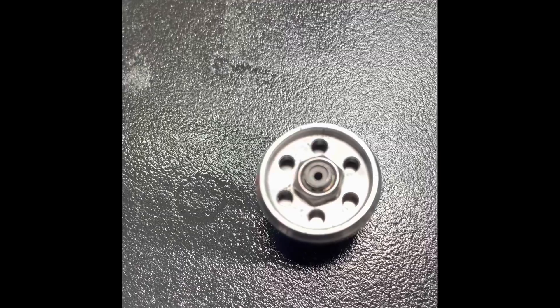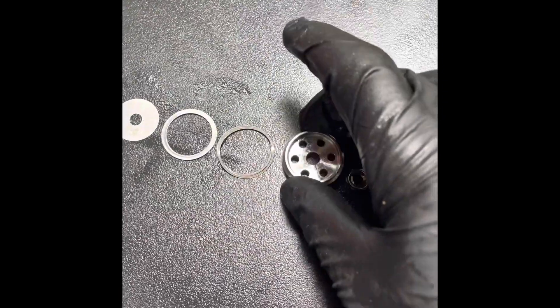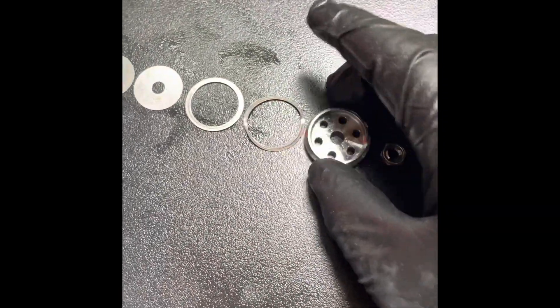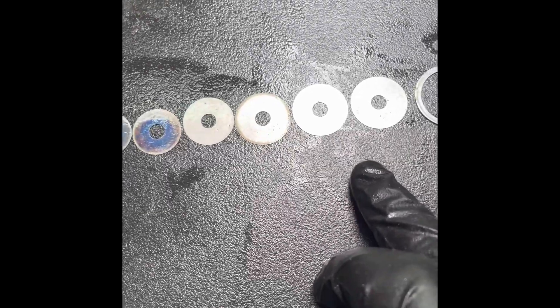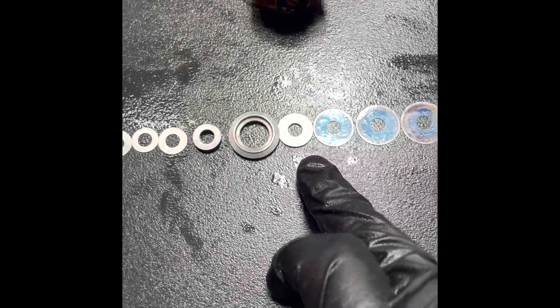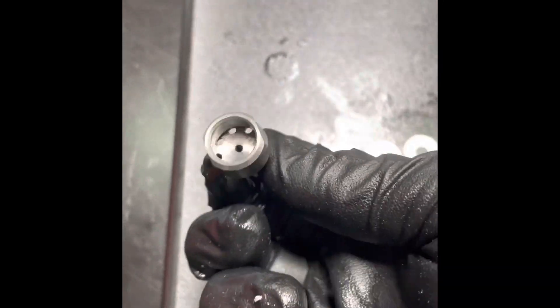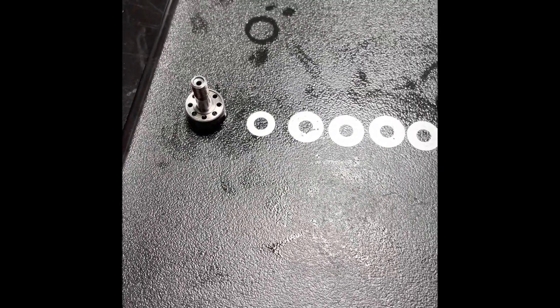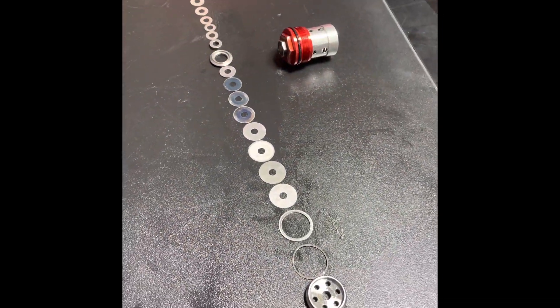Or you cannot run a shim stack and have it be an open bleed. Looking at the shim stack inside of the compression adjuster — this is the main piston, here's the back side of it. These two shims are wave washers and they act as a check valve. And then these are the shims for the compression piston, and these are the shims for the sub-valve, which is this piece right here. Again, this part is not found in OEM production shocks. You can get a similar feature inside of the MX-TEC triple adjuster that they make for Showa, KYB, and WP shocks. This is a very stiff setting, so we are going to revalve this for motocross, along with the main piston as well.